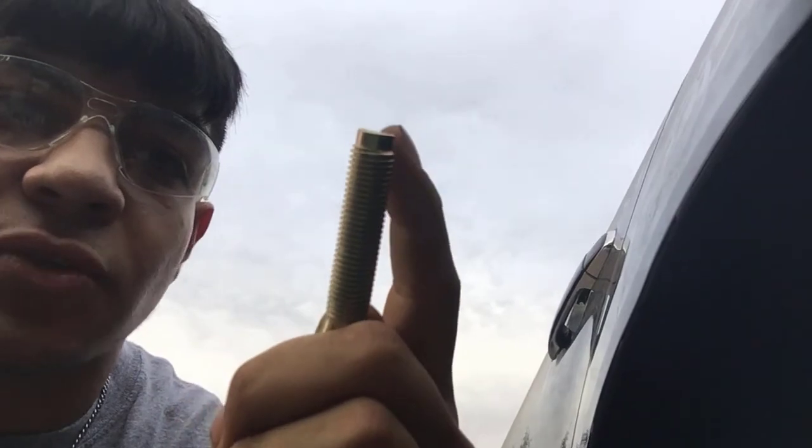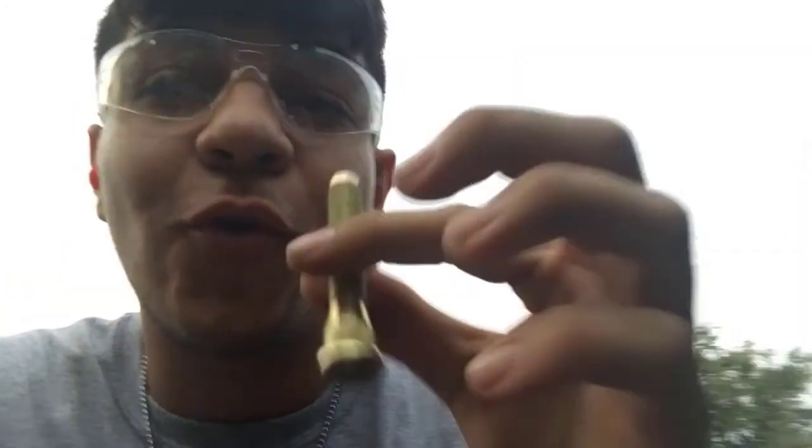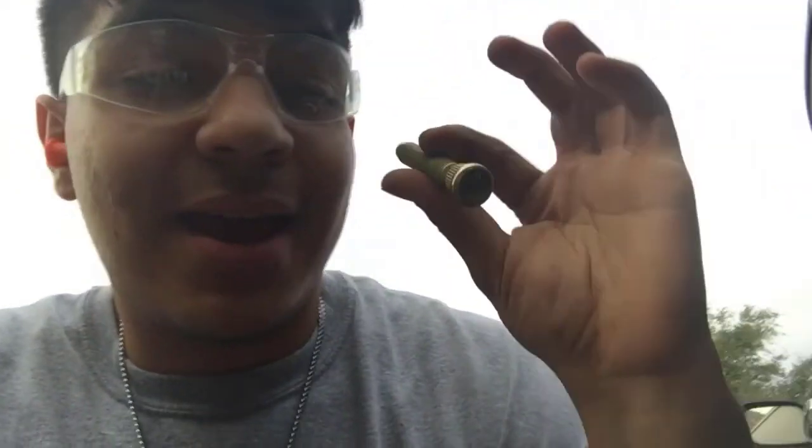Let's get into it. I'm grinding these down and then we'll try fitting them in. I've got my safety goggles on and earplugs in because grinding gets loud in echoed areas. We ended up taking one of the extended lug nut studs and completely grinding off that little notch at the top, and it just slipped right in. We've got to do this four more times on this side and five times on the other side. Thankfully this worked out and we didn't have to cut any threads off.